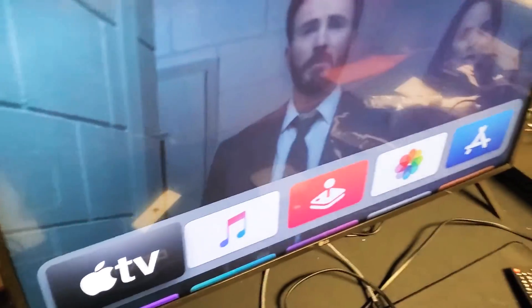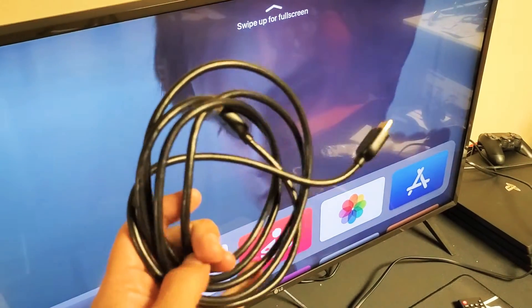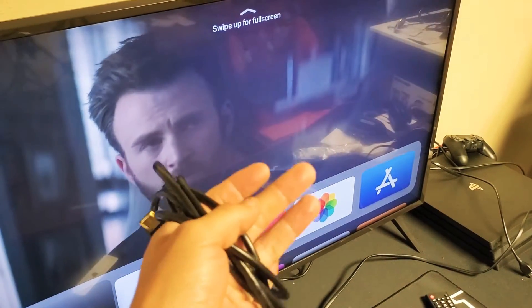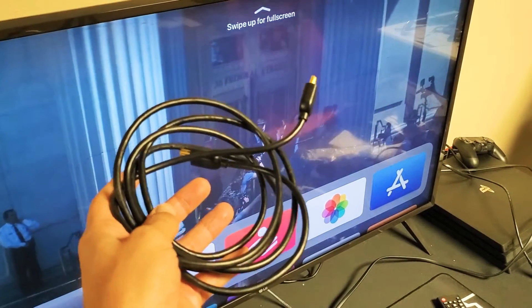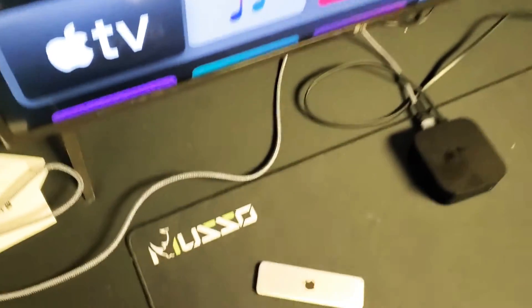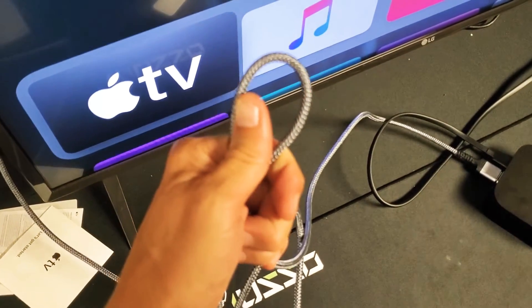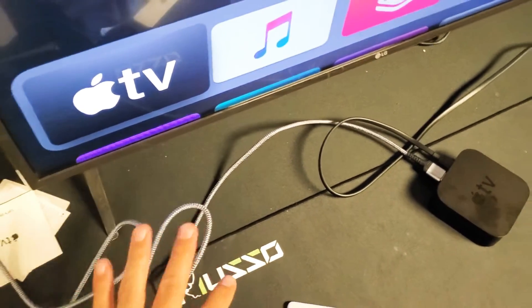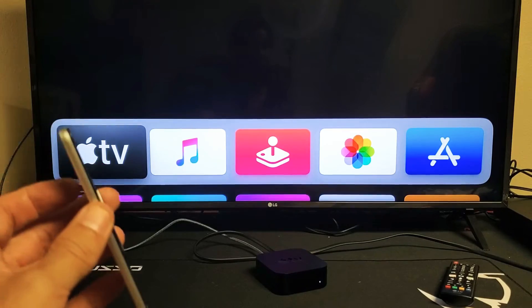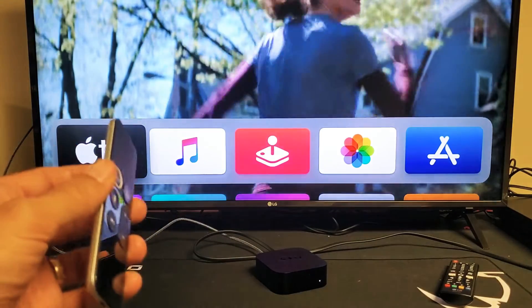If you've come this far, your most likely culprit is your standard HDMI cable. This is still a good cable, but sometimes it causes a black screen when playing YouTube on this particular TV — even though the same cable works fine on my other Apple TV. So what do you do? You buy a high-speed HDMI cable, not another standard one. I have a braided one here and I'll put a link below where I got it. Try a new high-speed HDMI cable and hopefully you'll be up and running.